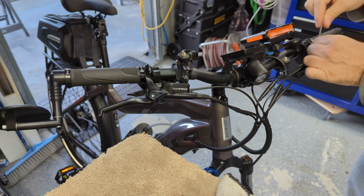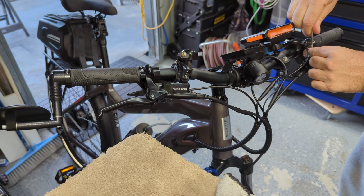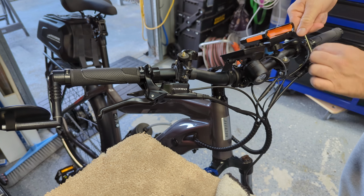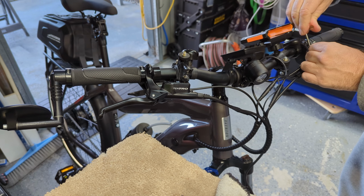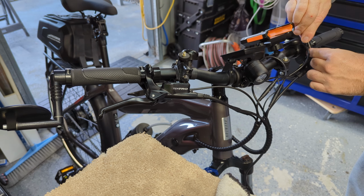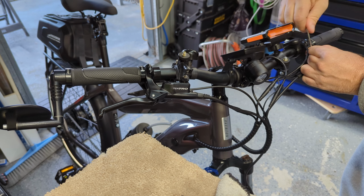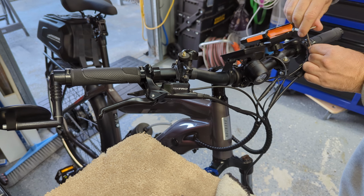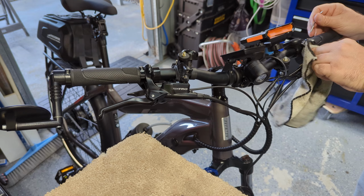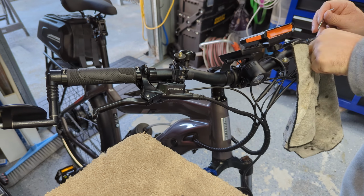I did that when I changed the oil filter in a car when I was doing work experience, I would have been in year 10 or so, like 14. I didn't check, no one told me to, but apparently it's a known thing, but not at 14 years old. The guy started the car up and it just pissed oil all over the workshop. I left the old O-ring on, and then the new one went on as well, and yeah, didn't like that. As soon as you started the car up, it just pissed oil everywhere.